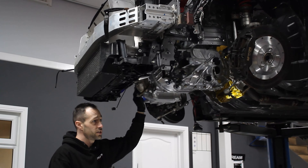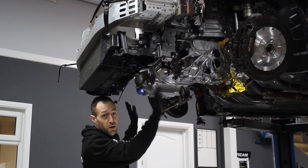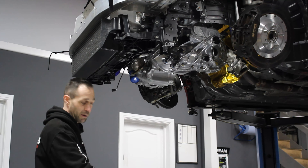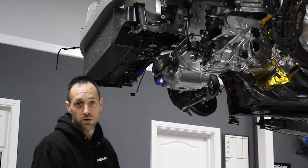That's everything off the engine now. You can see it's pretty loose - it's hanging in there on two mounts. It's had all the plumbing and the pipework taken off from around the front and the back, the subframe's down now as well. So it just leaves me to put it back onto the trolley under the two engine mounts and then lift the car off with the engine sitting on the trolley. Hopefully.